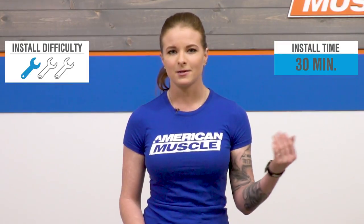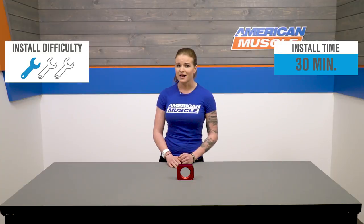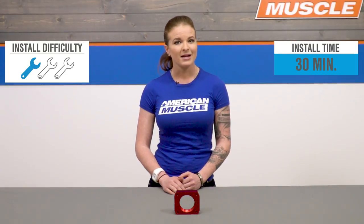So the install here is really pretty easy. You won't need anything out of the ordinary to get the job done. Just a few sockets and a flathead screwdriver. Should take about a half an hour's time, and I'm gonna call it a 1 out of 3 wrenches in the difficulty meter. You're gonna need to take off your throttle body in order to get the spacer on there.